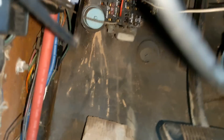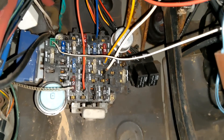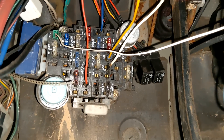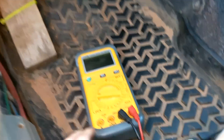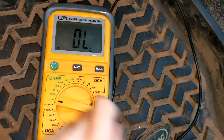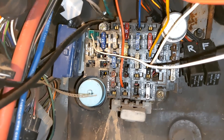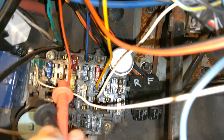The first link in the chain is our fuse box. The second fuse to the left is our blower motor - for us it's a 25 amp. We'll check the continuity to make sure it's not blown; you can also do a visual inspection. Take your multimeter and put it into beep mode - continuity with sound. Put the leads across the two metal leads on the end of the fuse and we'll see if she beeps. Our fuse checks out.